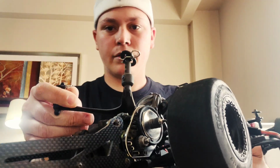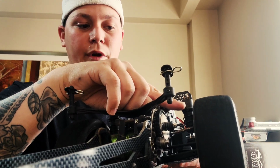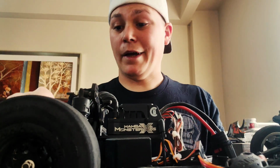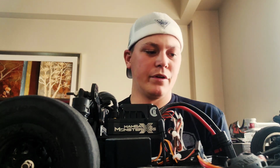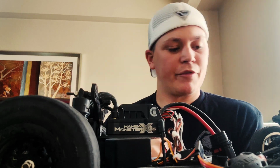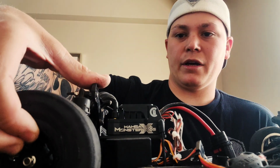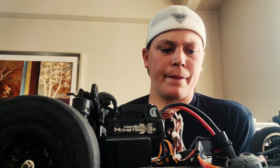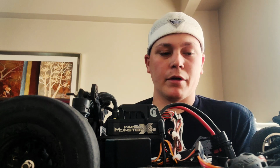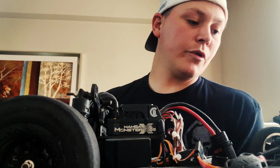Now, if I flip you to the other side here, yeah, see how there's 1 in there? I went out to test and tune a few days ago, and there was 1 on both sides. So, yeah, that's another thing. I believe the shocks are limited from the factory. I believe the front ones are limited on travel down. The rear, they've got fuel tubing bump stops in there to help with that. That helps out a lot, personally. I believe the limiting on the front is to keep the travel from pushing your frame and ride height up too high.